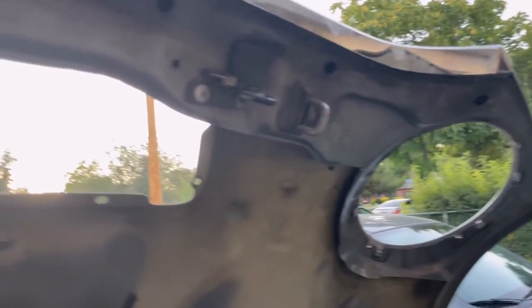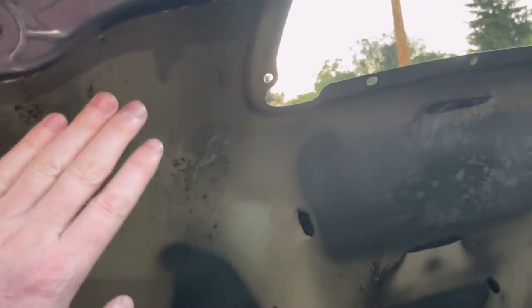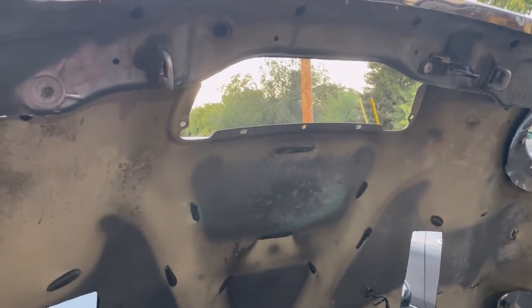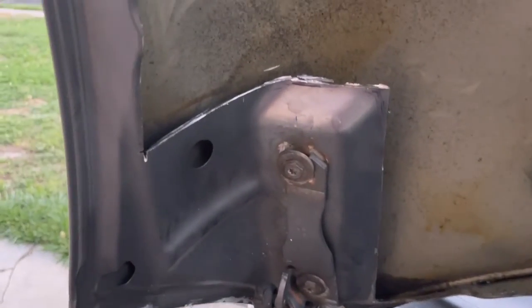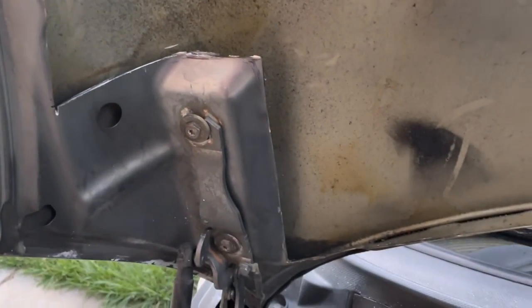You can see where I cut around the whole thing up here all the way around, and around the headlights. It turns out there are actually two layers here — the bottom layer is attached to a middle layer with spot welds in multiple places. I drilled those spot welds out, which allowed me to separate those two pieces, and I was able to get underneath and cut the middle layer out all around and match this line. I'll be pulling the hood off again to go around everywhere I cut with a flapper wheel, make sure all those edges are clean, and round them off so I don't get my hands cut.